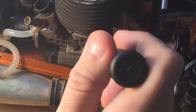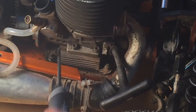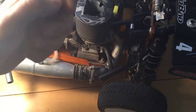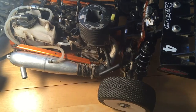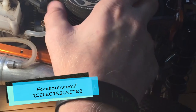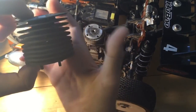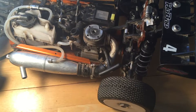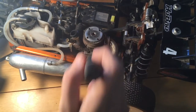In order to get to these bolts, it's kind of difficult because most straight tools can't make it. What you can use is what's known as a ball wrench, which has a little bit of an angle on it. The most common way is to use a glow plug tool, go inside to the top of your cooling tower, and remove your glow plug — because without doing that first, you cannot remove your cooling tower. Pull the cooling tower off, then remove all four bolts. Make sure you leave all your screws at the bottom and don't lose any. Once you have that done, you can get to all four screws without any impediment and take it out perfectly.